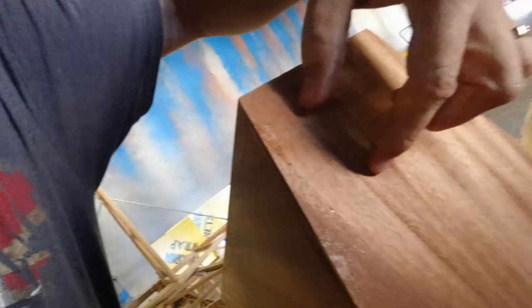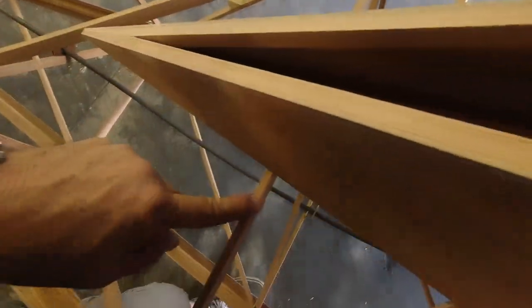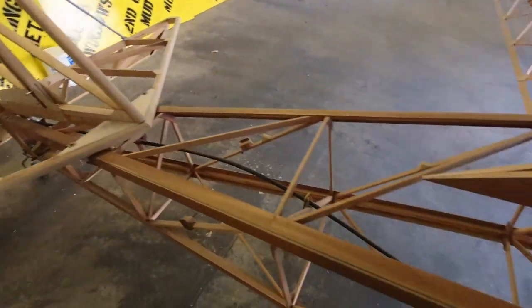Looking at the harness flying cub, it's actually a little less of a headrest and a little more of a shoulder rest — the top of this ends up pretty close to my shoulder blades, so having the seat belt harness come out right here is the right location; they would just fall right down on top of my shoulder. The cable goes down underneath this member and back to the bracket, going through the two holes we drilled in the elevator cable bracket. I'm going to get this centered up, get some lines drawn, and then work on getting those brackets put together.